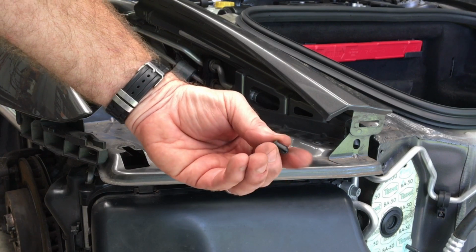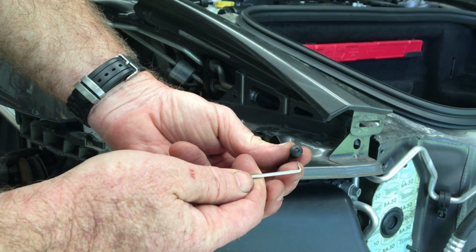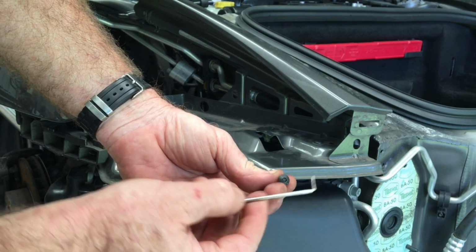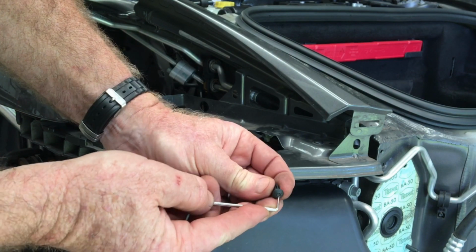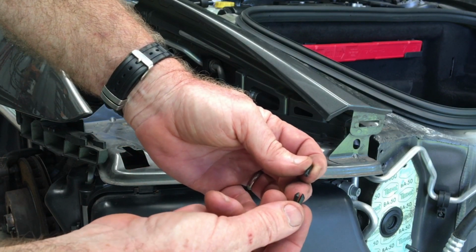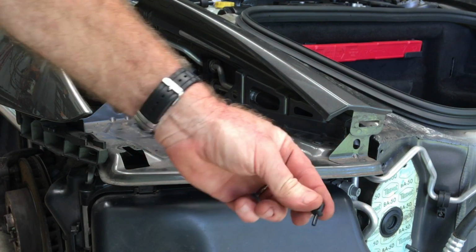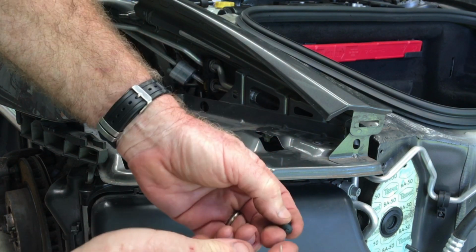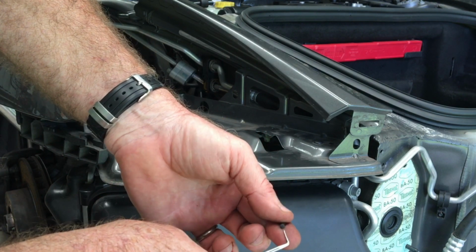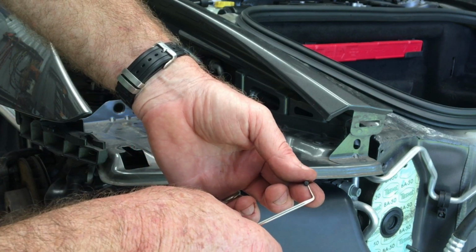All of these rivets that we need to remove, they look like that. They've just got a little plunger that is flush at the top there. The best way I've found to remove these is to use a pick tool like this. It's got a 90-degree bend. Then just put it on like that and push it out, and it'll just sit there like that, and then you can grab the other end of it so you don't lose it. And then obviously we're just going to have it fitted like that when we install, put it in place, and then just push it in with our thumb. Really important that if for some reason you mar the edge of this, sand it back so it's nice and smooth again, otherwise it's going to make it pretty difficult next time to put it back in.